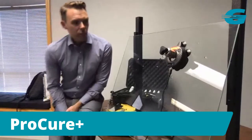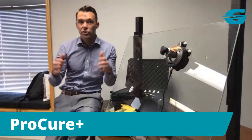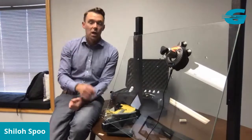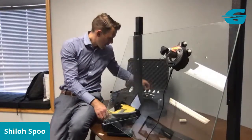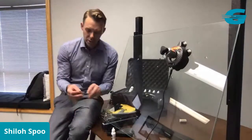Meanwhile, while that's flash curing the entire break, again, under resin pressure so that the resin doesn't shrink back, I'm going to set up my next step. As soon as we pull this off, I'm going to use one of these little film tabs and a little bit of pit filler. So I'll get those ready while this is finishing curing.